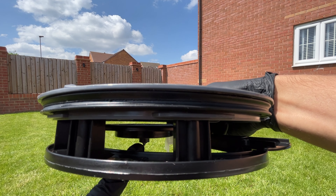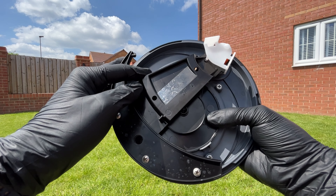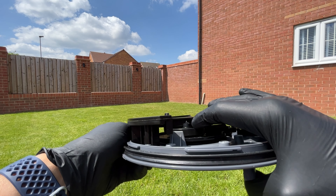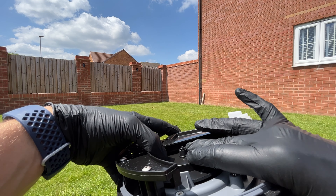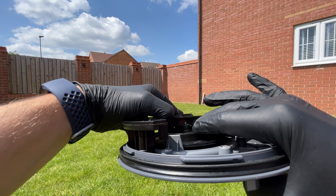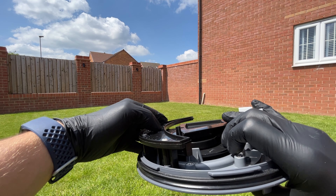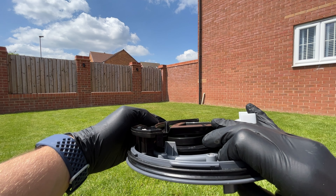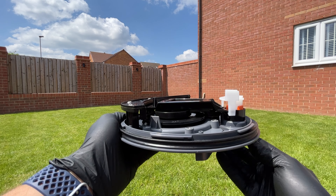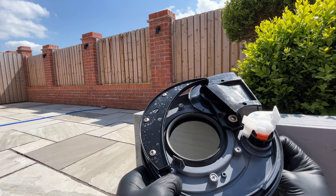With the pin on the plate moved to the other side of this guide rail, the whole assembly will work together and open the main plate. With the disc upside down, push down the plate with your right hand whilst your left hand lifts up the guide section, gently sliding the plastic pin under the guide rail. Then release, allowing the pin to sit flush to the side of the rail. It does take a little bit of force but not excessive. Now when we turn the orange knob the plate and guide move in unison as they should, repairing the mechanical assembly.